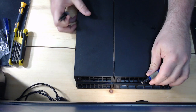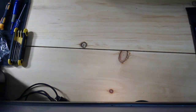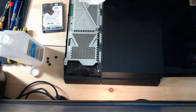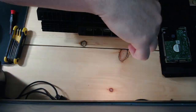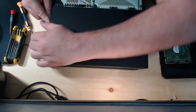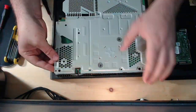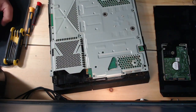So whatever happened to the $5 PS4? Naturally, I did all the work, filmed the whole thing, and then sat on the footage for about 7 months. So I thought about replacing the broken hard drive with a 1TB SSD for faster speeds, but it would have cost about $60 to do that. With M.2 drives about the same price, I saw an opportunity to replace this 1TB HDD in my personal rig with an M.2 and move it over to the PlayStation 4, still doubling the capacity.